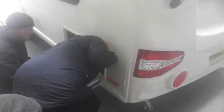As we come round this side, down here you've got access to under the bunk — a bit of storage you can access from outside. You've got the 240 cable that comes with it. Be careful what you're putting in there — obviously weight at the back of the van. You'd probably not want to put a big heavy awning in there; you'd want weight pushed about over the axles, or put it in the boot of the car. Down here, if you're aware of what these are, these are called drop vents — do not block them. If you have a gas leak, the chances are very rare, but if that has been blocked and you do have a gas leak, gas always goes to the lowest level. If it's not blocked, all it will do is drop out through there and disperse safely underneath the van.